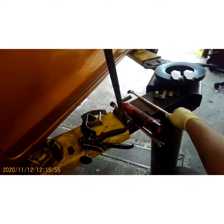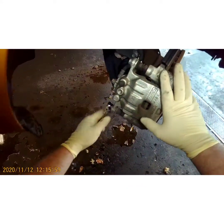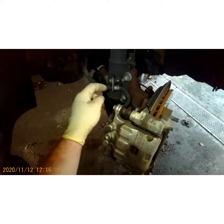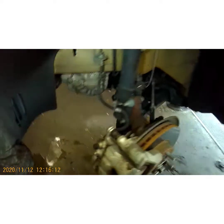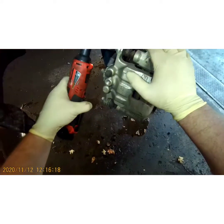Now we're going to turn the wheel out so we can service these brakes easier. The caliper bolts are 12 millimeter. On this one you're going to take both bolts loose — normally you can just take one loose and swivel it up, but this brake setup is kind of a tight fit. Unless you want to take that bolt out for more slack, it's easier to just take these two bolts out. I'll grab my electric ratchet — it's faster.